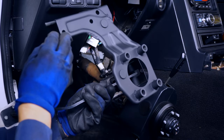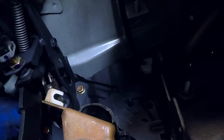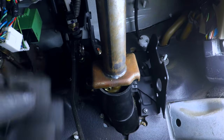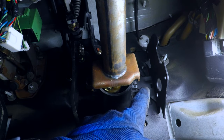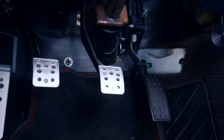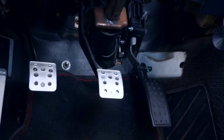I took the liberty of grinding down the welds a bit and giving this a quick spray of Rust-Oleum flat black. I think it looks pretty good. We got the bracket in, the fork for the steering rack reinstalled onto those studs, as well as the pin dropped back into the brake pedal. Next up, let's install the GM electronic throttle pedal right here on this new bracket. The throttle pedal is in. The pedal spacing is a little bit off from the Miata stock pedal placement, but there is a little bit of tweaking we can do by bending the pedal arms — that's something we'll do later.